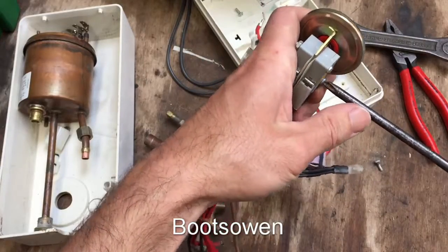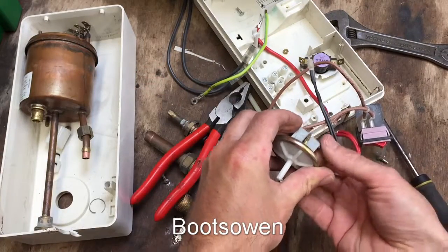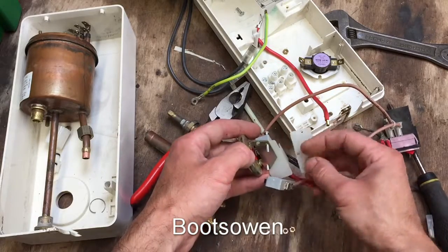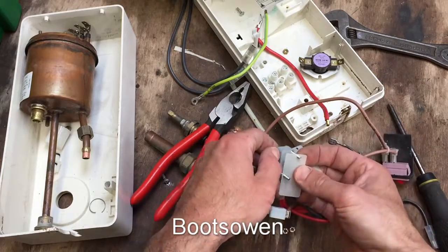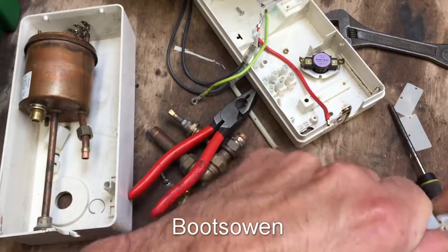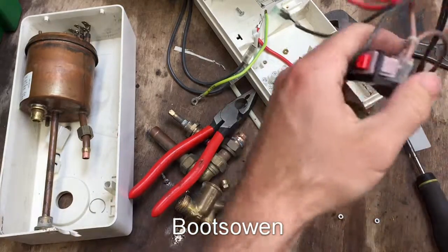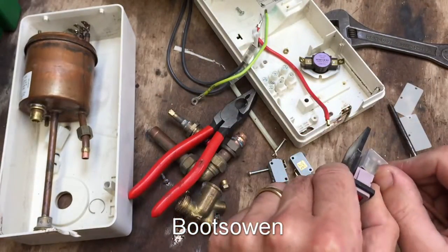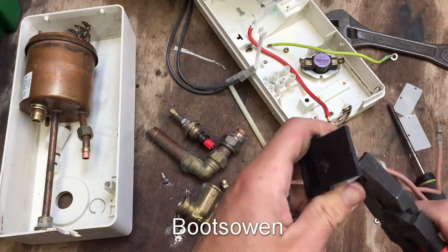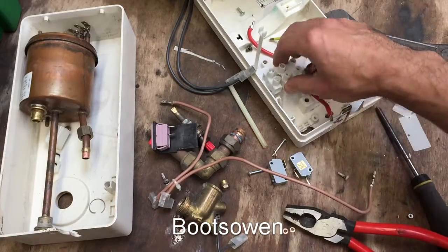Let's break this down. A couple of microswitches. I'm surprised this is only 20 years old. There are little insulators there so none of this gets live on it, but all of the metal parts were earthed as well, through the earthing sleeve onto the top of the boiler - and because the rest of it's metal, it's all earthed. I hang onto microswitches because they're handy for projects, but I've got a whole box of 100 of them and I don't know if I've ever used two of them. This little rocker switch with the spade connectors on it is more likely to get used - a spade connector on each end of a loop of wire is useful for wiring or hot-wiring a washing machine universal motor.